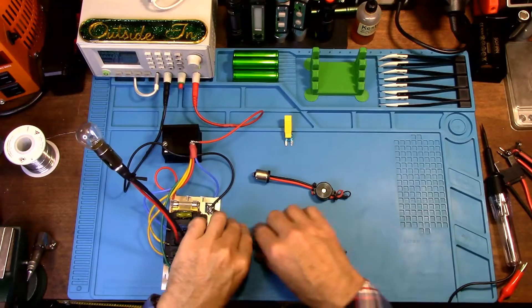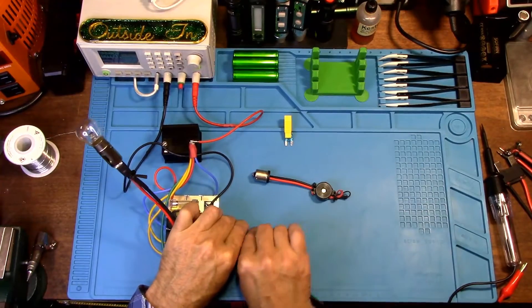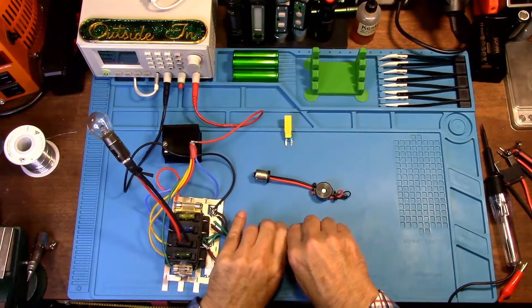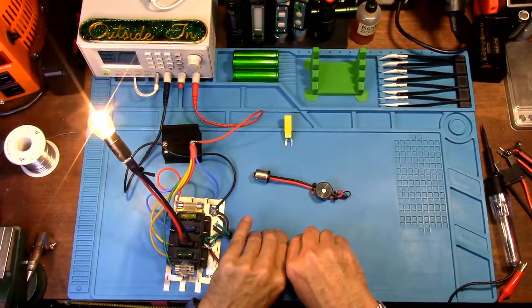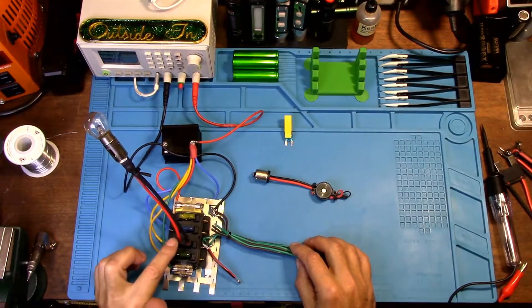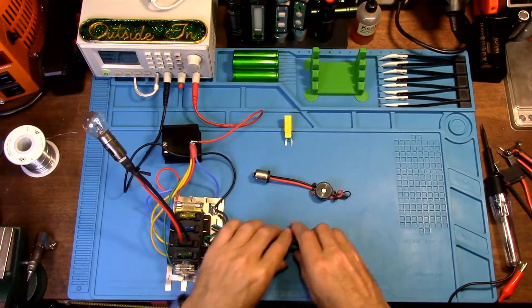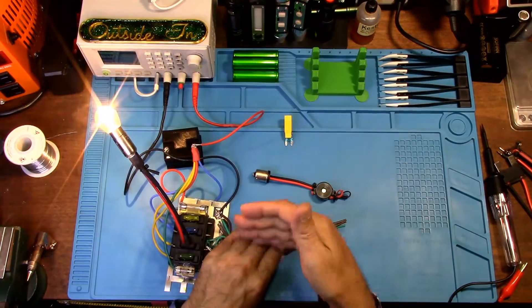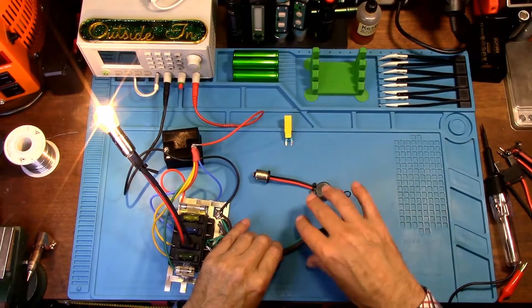You could go up and down your car, underneath, pulling and bending wires — just keep bending wires until you get that light to come on. If you have a permanent short, that light is going to be on as soon as you plug this in.